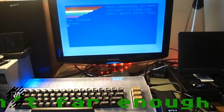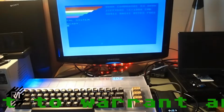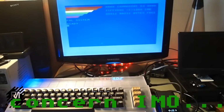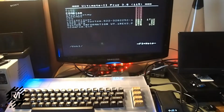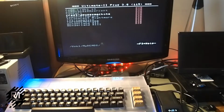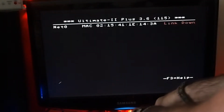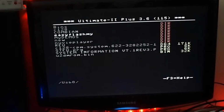Well, as you can see, the machine is powered on just fine. I've got my alternative JiffyDOS kernel here. This has been on for 6 minutes. Again, 4.9 volts. Although we're reading 5.9 inside, that might be an issue with voltage regulators or the machine itself. But as far as I know, this machine's never had any problems. Just be interesting, whilst we're here, to put it under a little bit of load. Have I got any SID player? Okie dokie, let's try running an REU demo, because they are going to be using a little bit of power, I think.